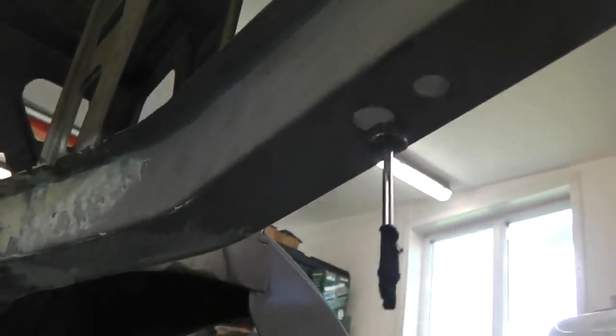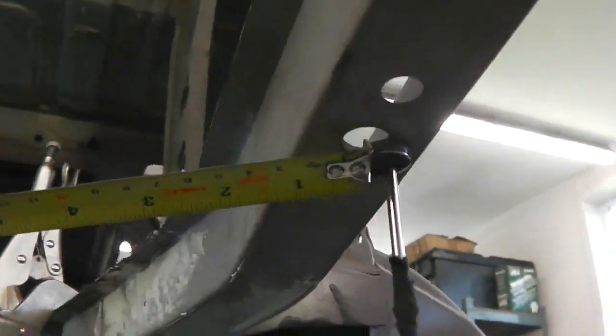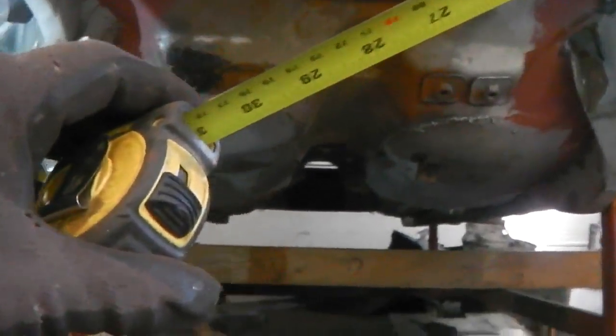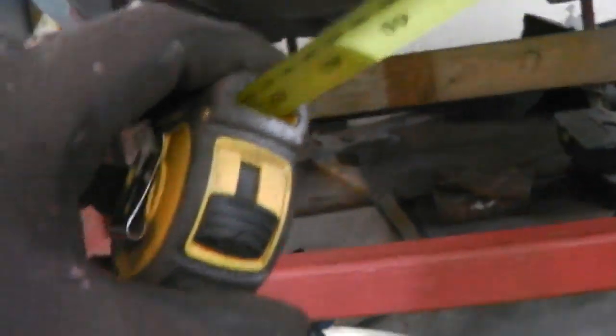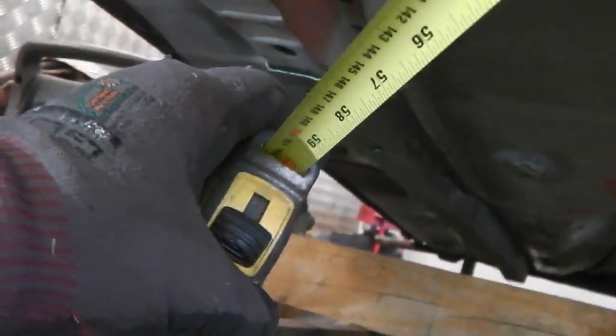So the tape measure is now going to stick to the end of that, but be right in the middle of the circle. I'll grab a tape measure with my other hand, and it sticks on. You can actually unravel your tape measure with no one holding it, and it's exactly in the middle. So we'd now head down this way to get those diagonal measurements. The magnet's that strong, it does what we want, and we head down to that hole.